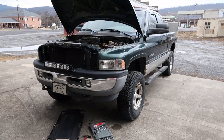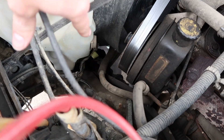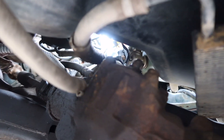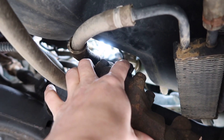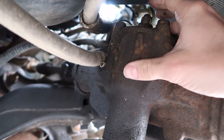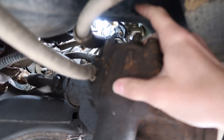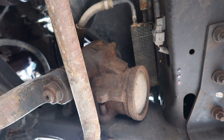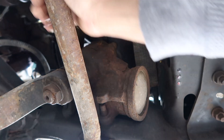It is a 2001, so I'd assume it's the factory gearbox. Here we have the gearbox — there is a nut, and then the bolt that goes down through it has an allen head where you can stick an allen wrench in. You simply loosen this nut, then tighten the allen bolt a quarter turn, and then tighten the nut back up. I'll do that, take it for a ride, and see if it helped.